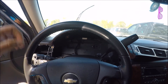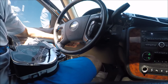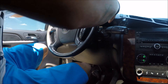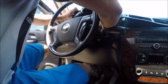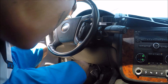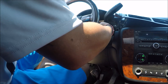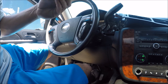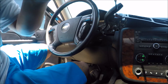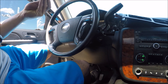Plug in the plugs on the back and grab this. Put the steering wheel all the way down, turn the key, shift her down. Slide it in top first, plug it in. There are four screws to screw the speedo in — two on the bottom, two on the top.